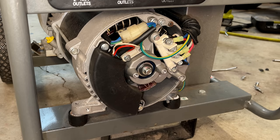Yeah, it's stuck, and it's a hard stop. So I don't think it's rust on the piston either. The connecting rod is broken, and it's just making contact with the crankshaft and stopping the rotation of the engine, or there's a valve stuck open, which they looked like they were closed. So, yeah, let's take a look at the piston while I rotate the engine, see if it's moving.